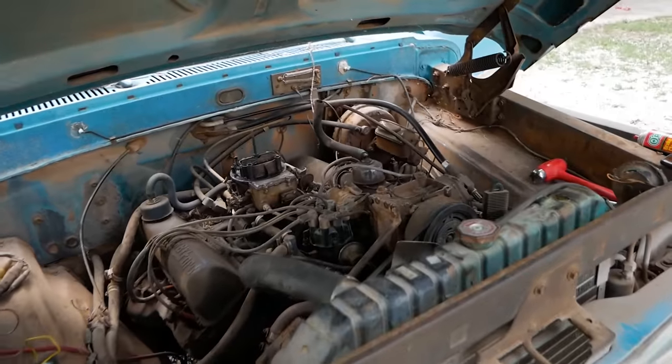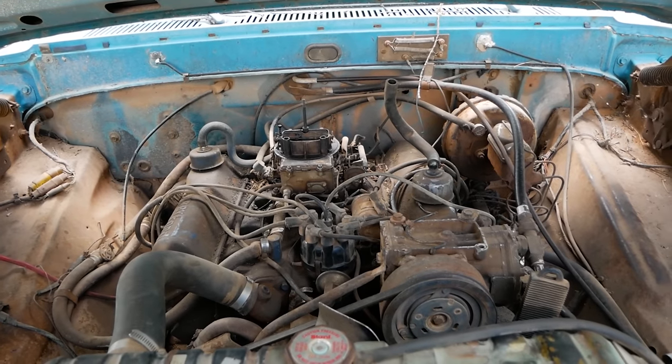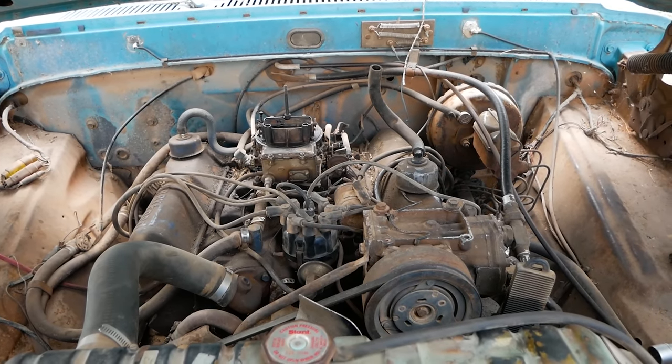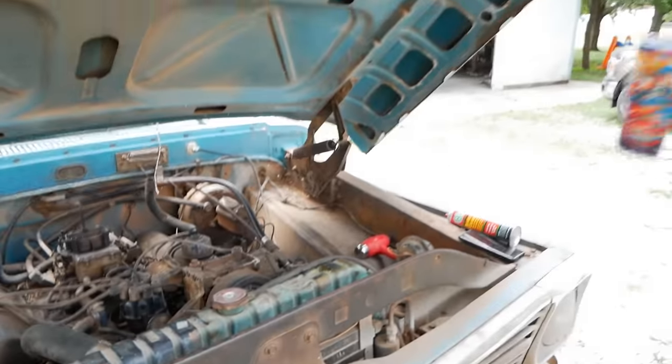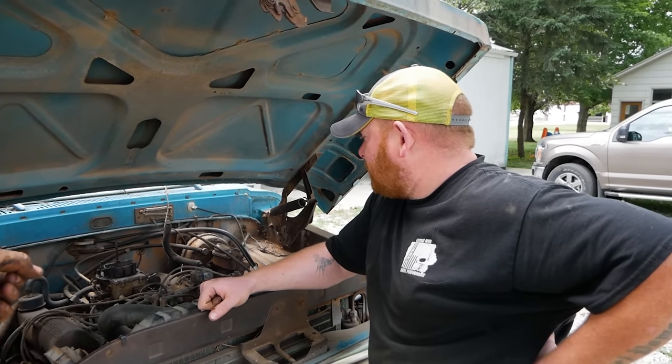So our power valve's definitely shot, without question, which requires me to pull the carb to do that. So, dilemma. I can pull the carb, replace the power valve, fix the extra rich issue where it's blowing black smoke, then I guarantee it doesn't idle because it's too lean.